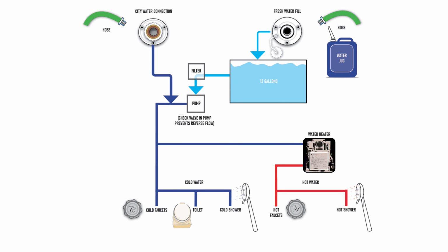Lastly, let's make sure the switches are in the off position for both the freshwater tank and the shower floor drain. And the last step, we'll turn around and we'll open all the valves to make sure your freshwater, gray water, and black water tanks are all emptied again to finish the process. And now your winterization process is complete.